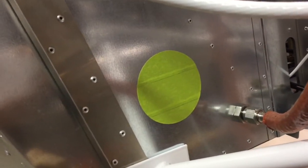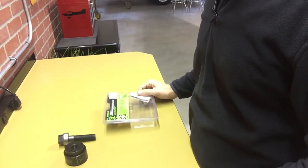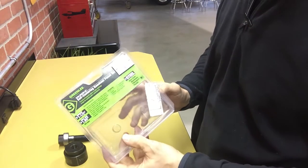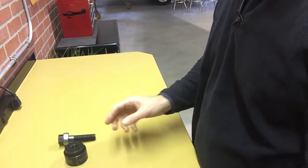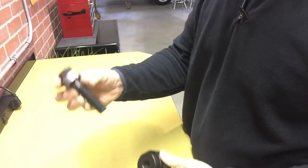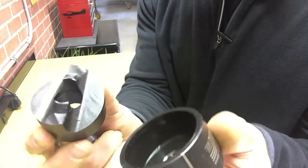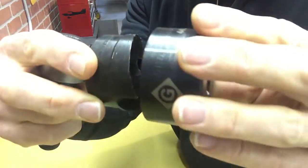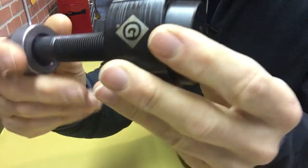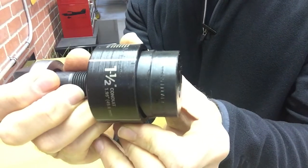The trick now is to cut a hole in the firewall, and there's a couple different ways we can do that, but I'm going to show you what I think is the nicest way. To cut that hole, you can use a fly cutter or probably anything you want to cut that out. What I got was one of these — they call it a self-centering knockout punch set, sometimes called a chassis punch. What you do is you drill a hole in the firewall just large enough to fit this bolt through. Then you have these two halves that go together — this is the cutting one — and it just punches out a nice perfect hole in the firewall. You insert this in here, and when you tighten it, it just drives this punch through. That's what I'm going to do.